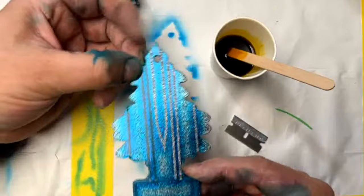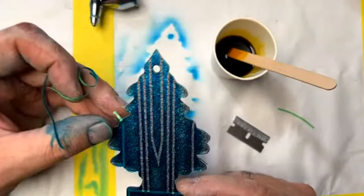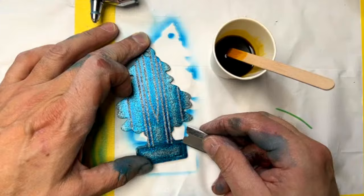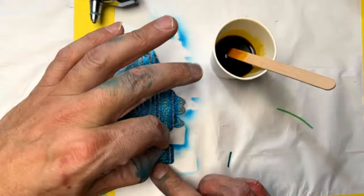What are some pros and cons to pin striping with oil-based versus urethane? The oil-based is harder to clear coat over — you've got to be really careful and start with really thin coats, or you could have a reaction. I haven't played with the other pin striping paint so I really don't know. I might be able to answer that after this weekend — we're going to be using One Shot there. We do have a class: Mr. Oz is coming in from out of town and he is teaching a pin striping class this Saturday. I'll be taking the class, Ashley will be taking the class, and there's a total of about ten or so — I think Ryan's going to take it too.